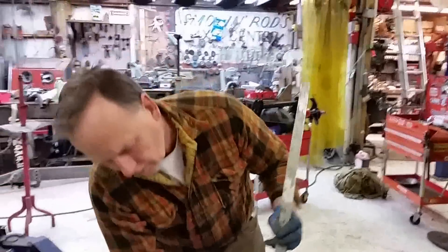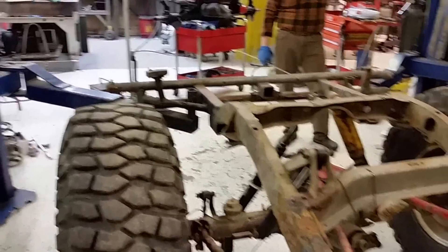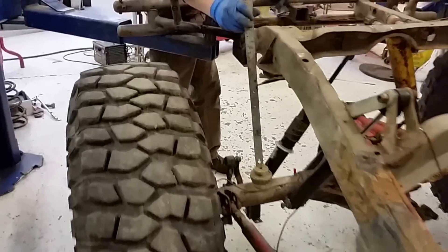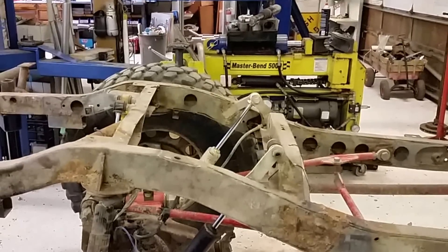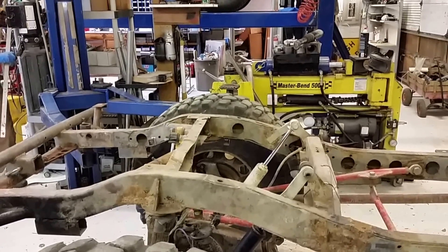That's all gone. Designed to ride with about 12 inches of travel, so we're at about 6 inches right here. Run her all the way up. See, I'm actually getting potential of 13, 14 inches out. I want you to come around this end — can you get on an angle where you see the slope on the shock? So we're going to run down to ride height, and right now the angle on the shock looks pretty good. You're going down, the shock's going down, and it's working.